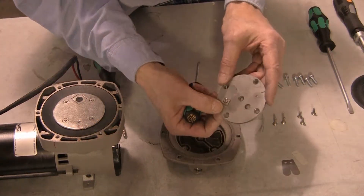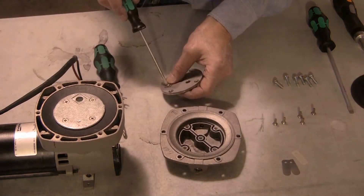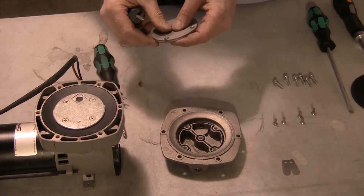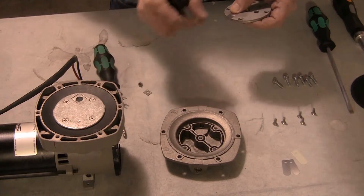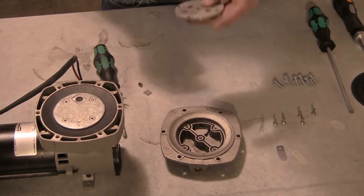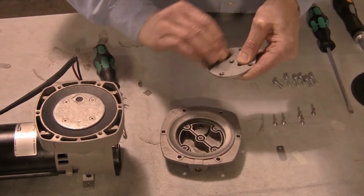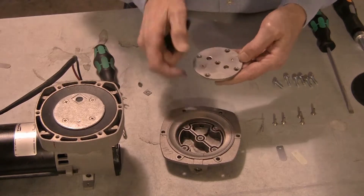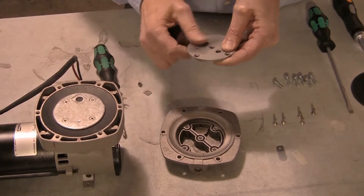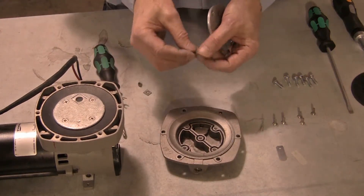The flap valve is secured with a slotted screw and a small keeper plate. It is labeled 'up' in the lower right-hand corner. Note the orientation of the keeper plate for correct reassembly. Remove the slotted screws that secure the keeper plates and flap valves to the valve plate. If the plate is corroded where the flap valves seat, clean the surfaces with a mild abrasive, such as a Scotch-Brite pad, before installing the new flap valves. This will ensure that the flap valves fit flush against the plate when installed. Wipe off any remaining residue. Be careful to avoid removing the alignment mark you made earlier on the valve plate.